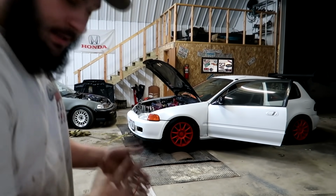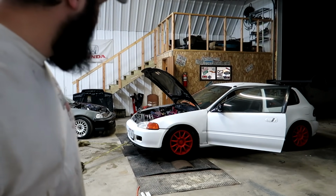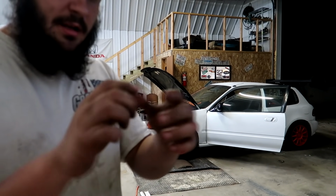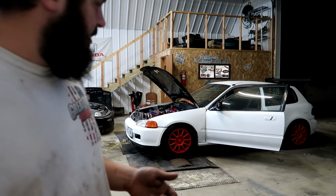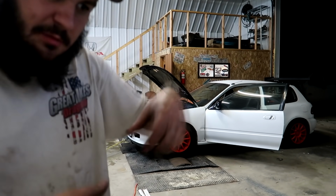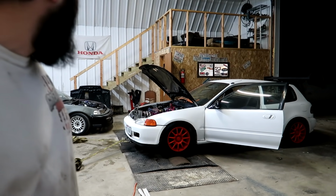Okay, now I'm full of coolant. Hose is fixed, I got a clamp on it. It had a clamp on it, but it was wedged against the block, like the head where you tighten was wedged against the transmission, so you couldn't tighten it anymore. So I put the clamp on where you could get at it a little better, and it's not wedged, giving you false tightness kind of thing, and I think that's what was going on there.